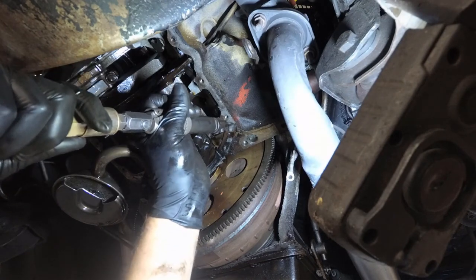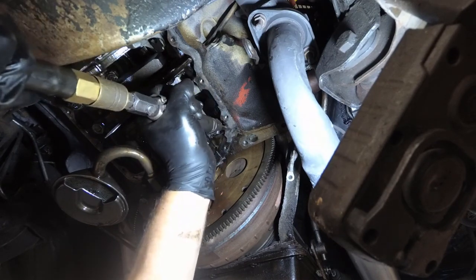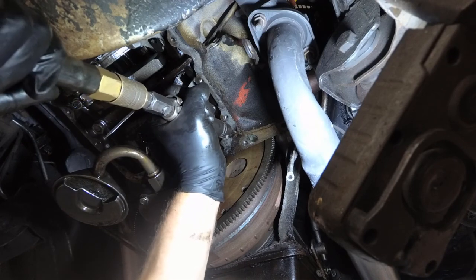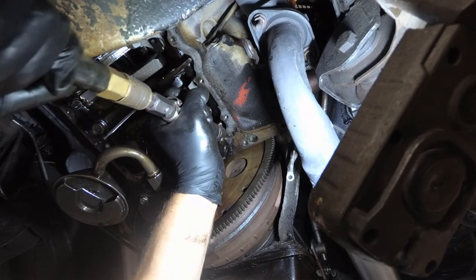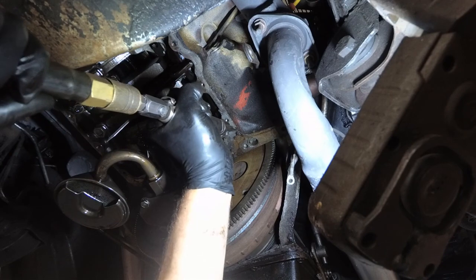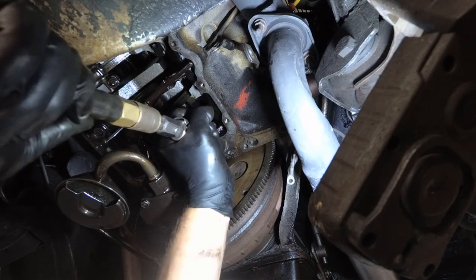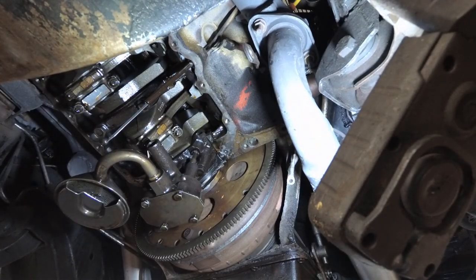So that's what's involved in scraping that gasket off. I've had this air scraper for decades — used to do inline six-cylinder Jeep engines where the gasket was like cement. That works quite well, and the rest we can clean off with a hand scraper.